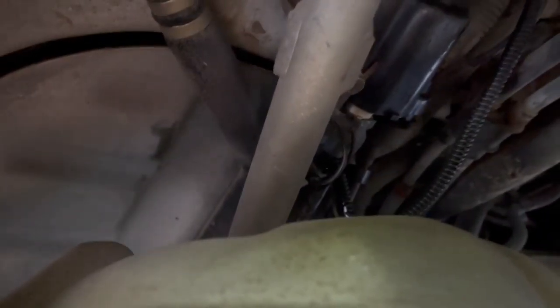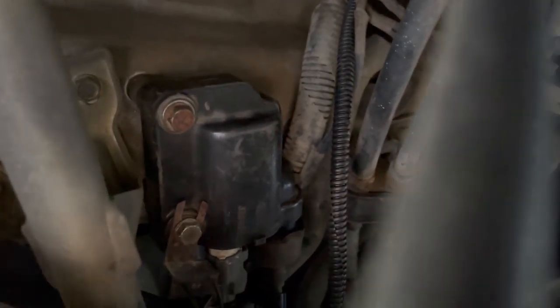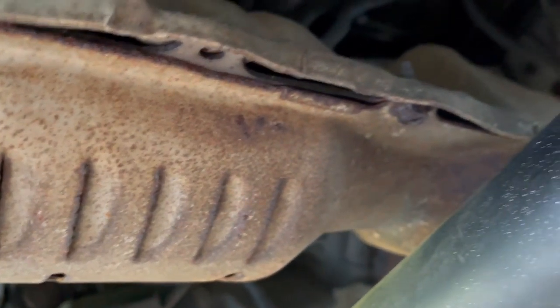It's hard to get a good camera angle in there, but the coil is installed. Both plugs are connected, along with the plug for the distributor. There's also this little capacitor that you have to secure with one of the bolts — just keep track of what it looks like when you remove it. That's the other bolt, so it's all tucked up under there. Now the only thing left is to put the heat shroud back on, and we'll be done with the underside of the car.